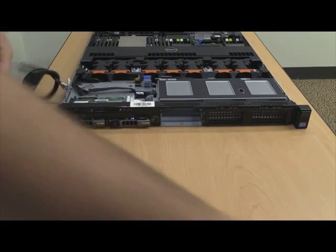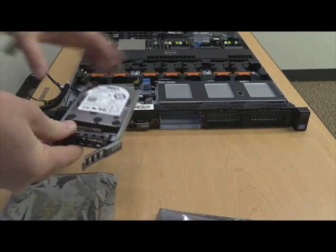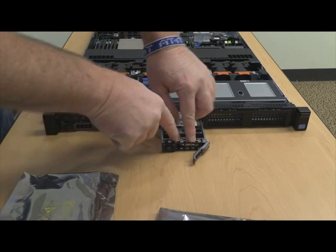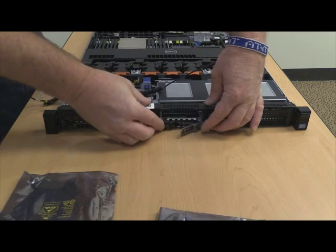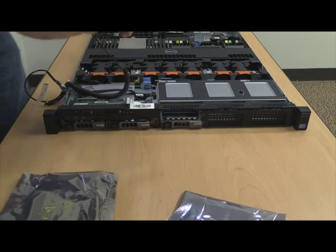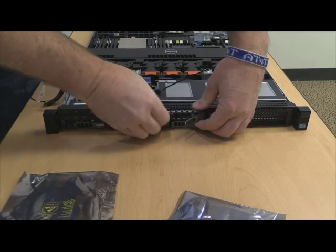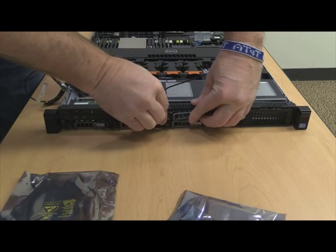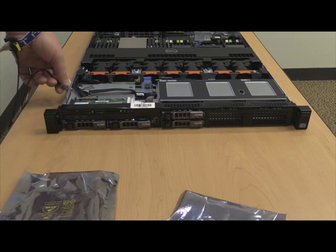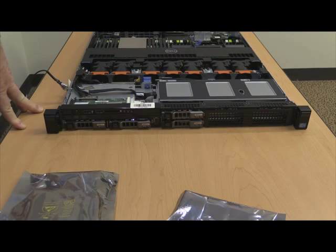You should not have that much trouble with most of the new ones, but these, in this particular case, for example, might not be brand new ones, so might have been a little twisted up on these items here, so you just squeeze them down a little bit if you're having trouble, and it should slide in. And there we go. Now you've got all 4 drives in, and you're ready to restore the system using the standard restore procedures for CMS.